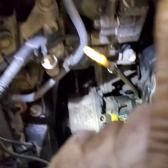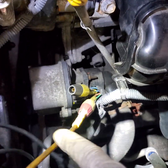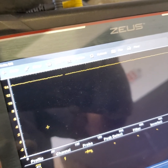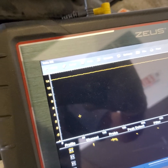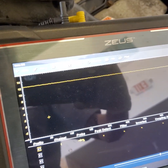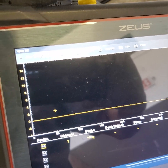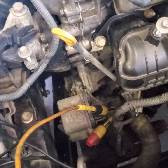The car is still on. I'm on the green wire, and that should be constant voltage — and I'm getting 14 volts right here. When you turn the key off, this should fall close to zero volts. Turn the car off — and there you go, it slowly drops down to zero. Now we're going to go to the communication line.